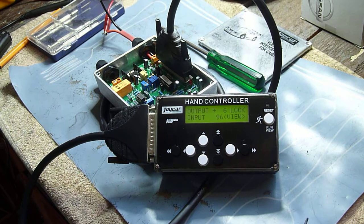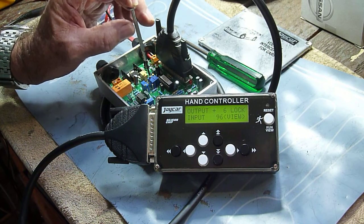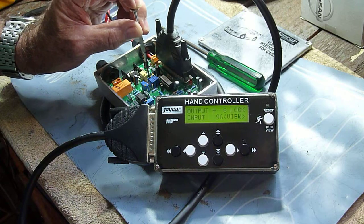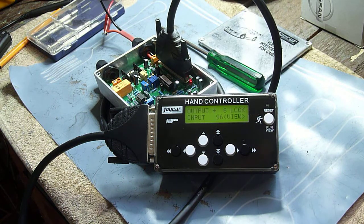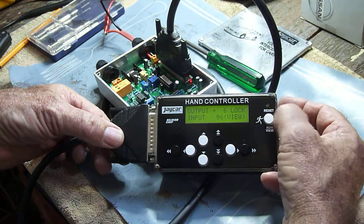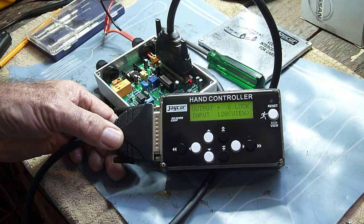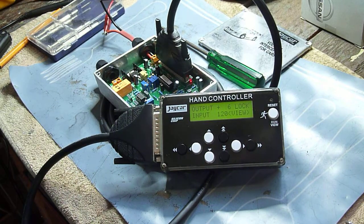Your MAP voltage will be a little bit higher at idle, then once it switches on, it'll drop down. Now if we want to make any adjustments, this has to be turned on, so there is a trick to it. There's a unit here — the second blue thing down — called VR4. The way that is set up, if I take that one turn, you'll see that the red LED has now come on. That means there's power going through that and I can get it up on the screen. We're in view, still going through with the load points, but we still can't change these.